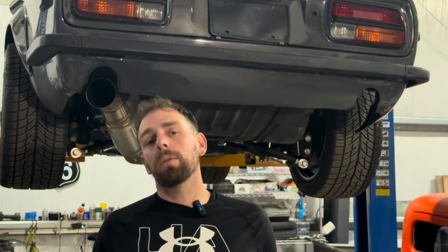So why did I want to show you this suspension? I did notice that there's a lot of changes on the suspension since I originally adjusted everything. I noticed there's a lot of settling. Coilovers settle, especially BCs, QA1s, you name them, they like to settle. I actually need to readjust the coilovers a little bit, try to get the right height where I want it to be, but I also want to show you a little bit of an issue that I found.